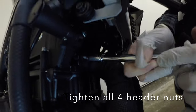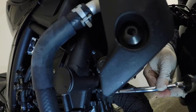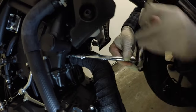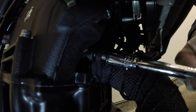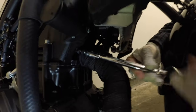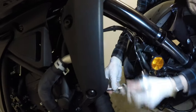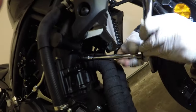On the front, there are four nuts on the exhaust flange studs. Go ahead and snug all of those down. Unfortunately, the glass fiber here was so bulky around the flange — it made getting the flange back on kind of hard; I should have left a bigger gap. And it also makes getting these nuts back in place quite difficult. If this looks easy, it was not — in reality this took well over an hour.